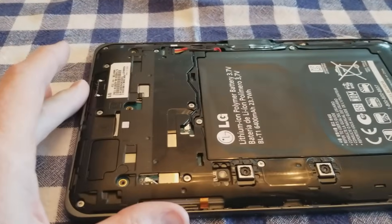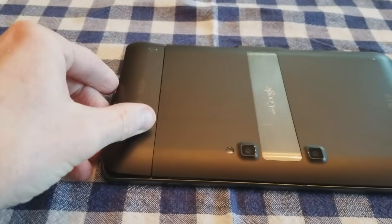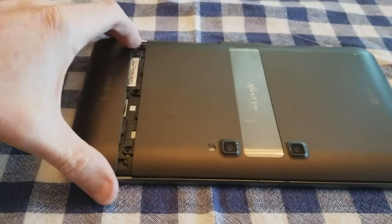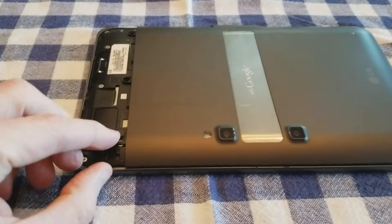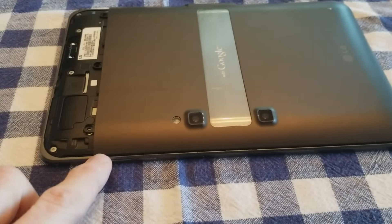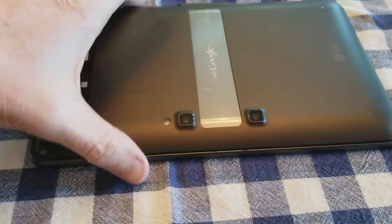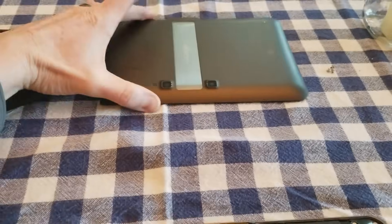But in this case I actually had to take the tablet back off. This piece simply comes off using two hands — shoots right up and comes out very easily. You then have to remove two or three little tiny screws, and then get a jimmy rig tool — a guitar pick, flathead screwdriver, or plastic tool. I'd recommend plastic so you don't chip the side edge. You work your way around the tabs and remove the back cover.